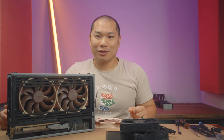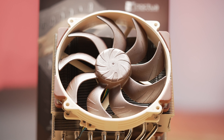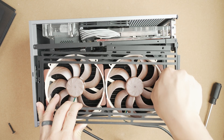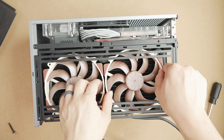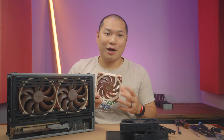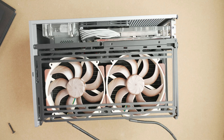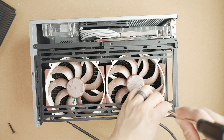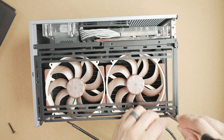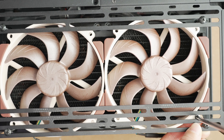I was still a few months out from the launch and I wanted to get an estimation of the performance. So it's important to note this is a preview of the fans as it pertains to radiator performance — I really don't want to do any serious noise sampling or interval testing until the square version is released. One difficulty of using this fan on a 280 is the round version has holes that line up to a 120mm fan's hole pattern. While there are adapters for 120mm fans on 280s or 140s, those most often have the outer portion blocked off, and here you'd miss out on a significant portion of the airflow. Fortunately with this build, I've got my rad mounted up in a way where I could just use those longer fan rad screws to hold it in place.